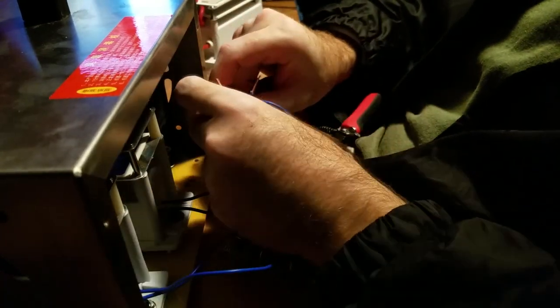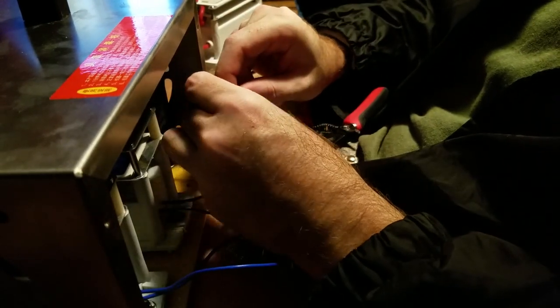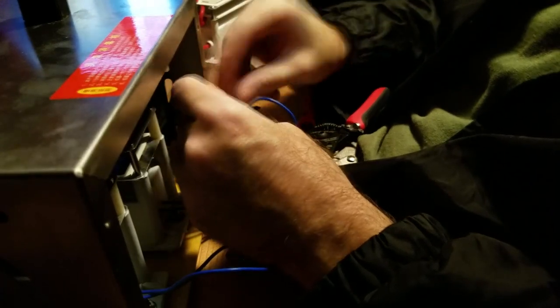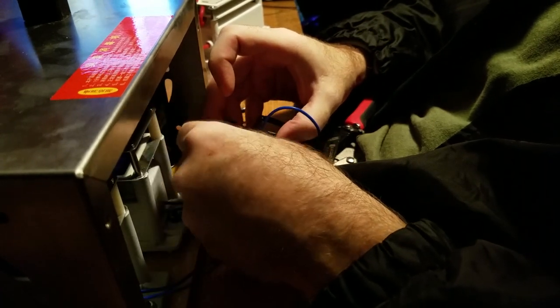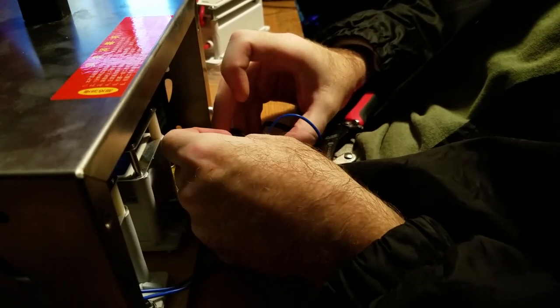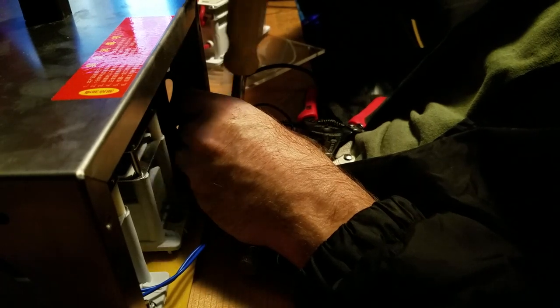I'm going to take this wire that's coming off of the fan, the black wire here. Make sure it's spun up nice so it doesn't fray. Wrap it around one of these copper wires, so I get a metal to metal connection. Tuck it under a little plate here, which is for screwing down to make sure that there's an electrical connection here. One of these I'm having to jam in there pretty good because of it being a little bit longer than the connector here. Screwing it down. Looks like it's a plenty good electrical connection.